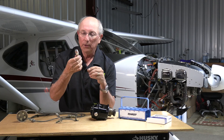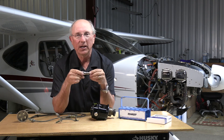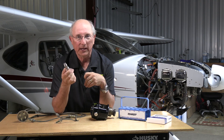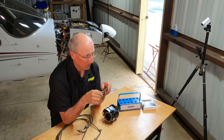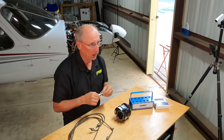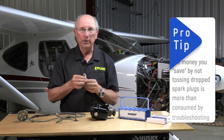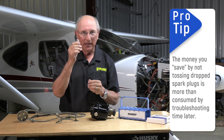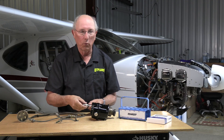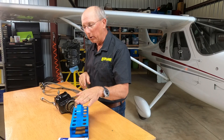One thing to be very careful about with aviation plugs — they're different than automotive plugs. There's an old saying in aviation: if you drop it once, drop it twice. The second time, into the trash can. There's an insulator in here which can crack if you drop it on a concrete floor and you can't see it. So you have to assume that if you've dropped one of these expensive spark plugs, it is ruined. Always treat them with care. Keep them over a workbench and put them in a holder so you have somewhere to keep them organized.